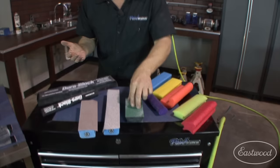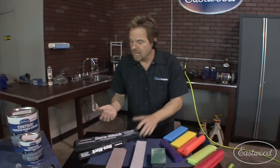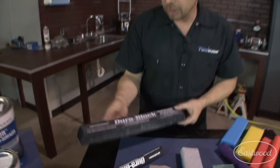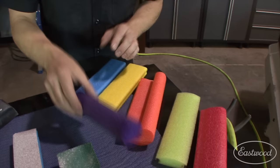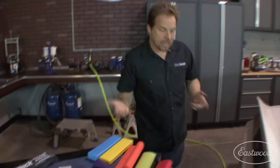Speaking of sandpaper, here's what I recommend to block filler: 36, 80 grit, and 180. You can fine tune and pick and choose — 60, 120, whatever is available. For me, 36 is where I want to go to town and establish my shape fast. Then follow that with 80, then 180, and then you're ready for primer surfacer or contour poly. There's all kinds of great equipment to block with — durable blocks of different shapes, soft sanders which I've become particularly fond of. These are already mapped off of existing vehicles so you can match your shapes to different areas. You can also make your own using radiator hoses, paint stir sticks, all kinds of stuff.